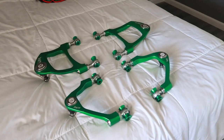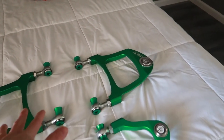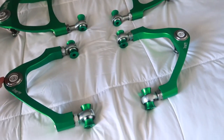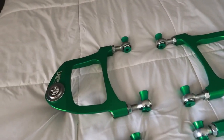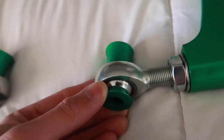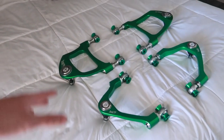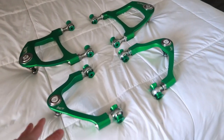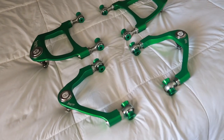We officially now have the entire suspension catalog from Serial 9, introducing their fairly recent rear upper control arms. On the bottom here we have the front upper control arms. These are seriously superb quality — billet aluminum, Teflon-lined joints so dust doesn't intrude inside the joint. These are incredibly adjustable. With the Sports Series you can adjust from zero to negative four degrees of camber.